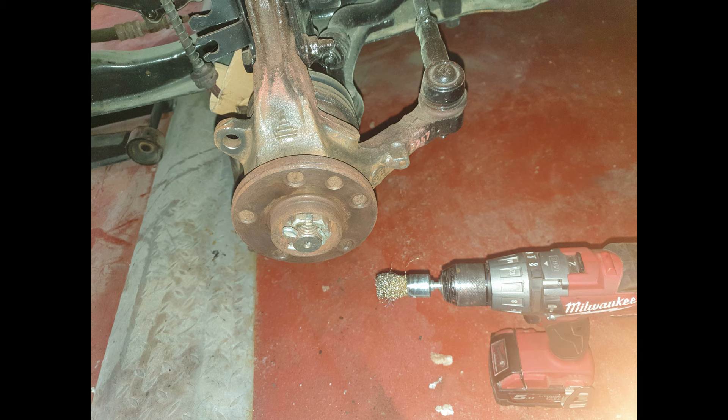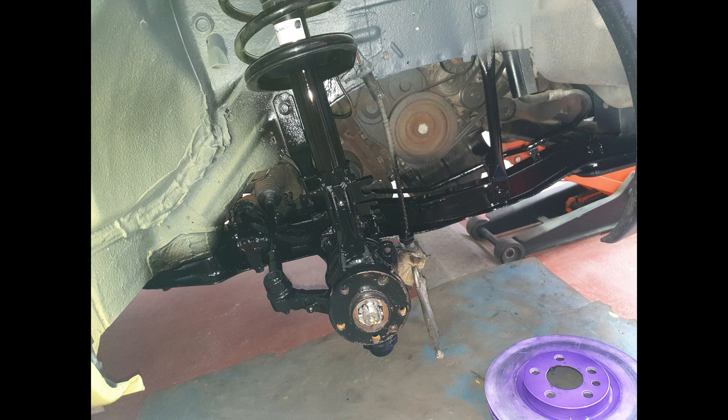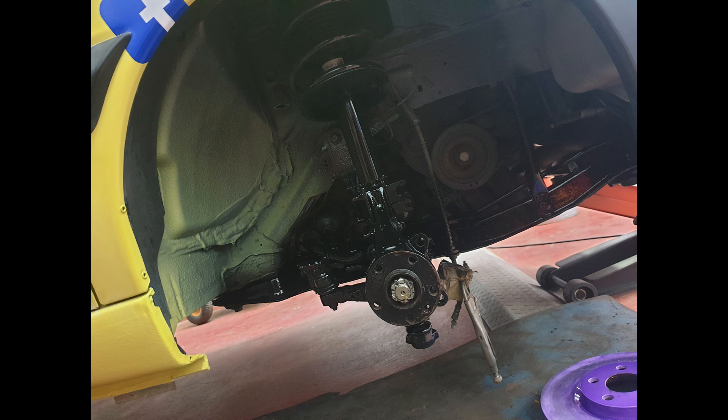This is the hub stub itself — it was also blasted. All old brake discs were removed and the components were also powder coated. This is the subframe finished. It was treated with Denitrol and painted with primer first. New shocks and springs are both brand new, as are the CV boots. In the background you can see the powder coated disc in candy purple — that will come in part three of this whole process.